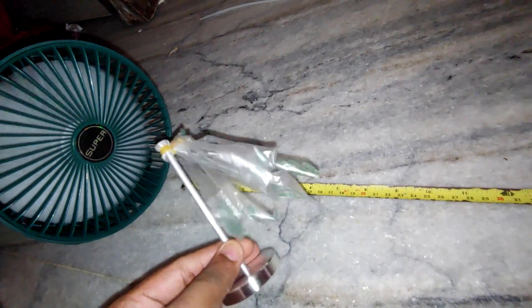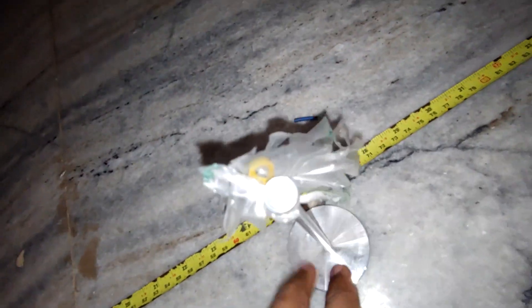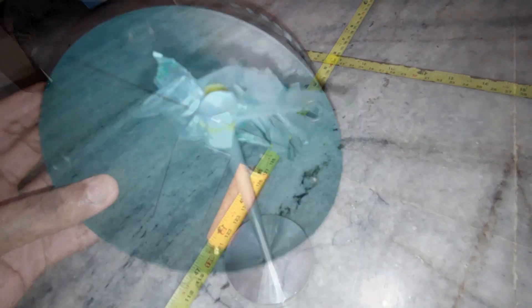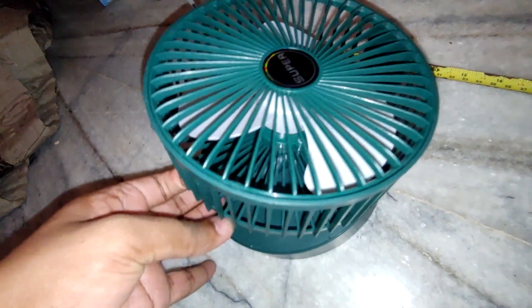The fan did not change color — I bought two of them so we can have a little fun. So how much worse can it get? I actually charged the battery that came with this one and it showed only 300mAh — that's really bad. But that still should not impact the fan speed when the battery is fully charged to 4.2V, so there is something else wrong with it.